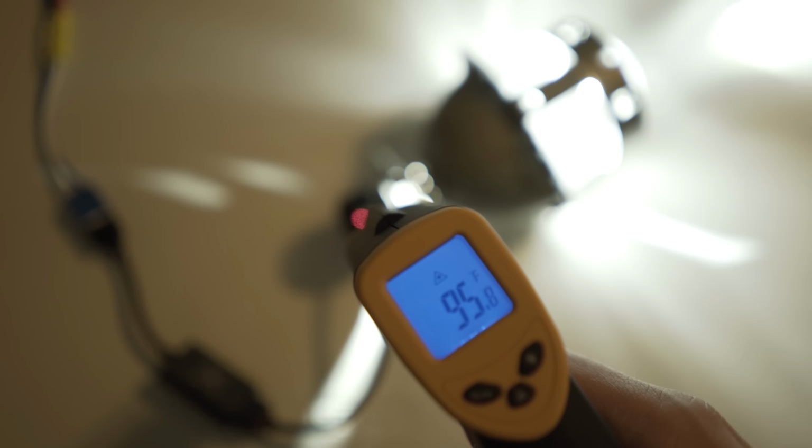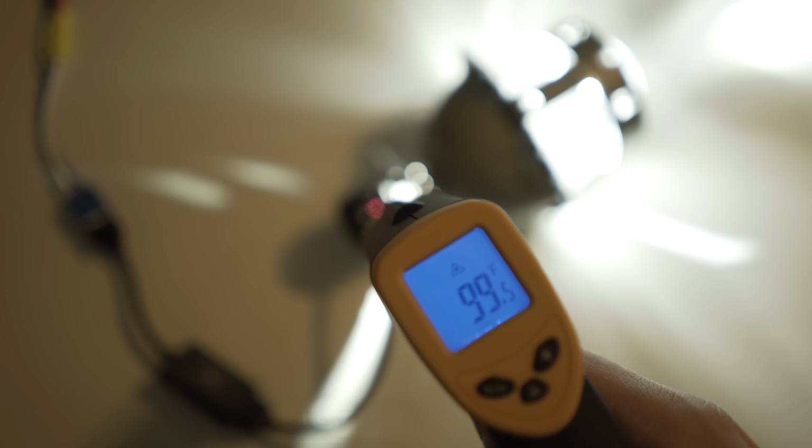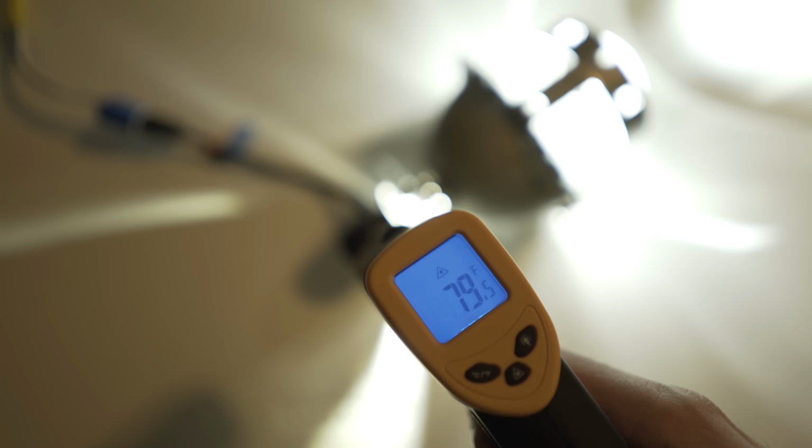Both of these kits stay really nice and cool. You don't have to worry, they both have fans on them. Even in an enclosed style headlight, you don't have to worry about that. The heatsink on the Hikari got to about 100 degrees Fahrenheit. Again, nothing to worry about. The TECHMAX was about 88 degrees Fahrenheit. We see anywhere from 80 to 100, 110 maybe from our tests.